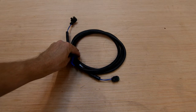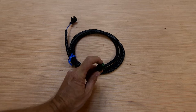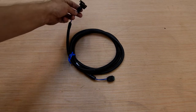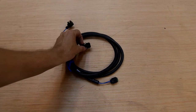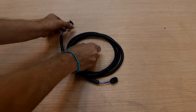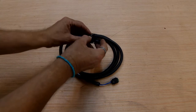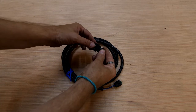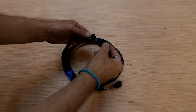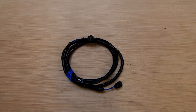Next up is the fuel pump wiring harness — it's different from the main wiring harness. It has a green and black oval-shaped connector on one end and a black squarish connector on the other. The green-black oval connector goes into the fuel pump itself, and the other end pairs with the housing for the fuel pump connector we just set aside. At this point, snap the two pieces of this connector together so you don't lose it and so you remember how it pairs up.